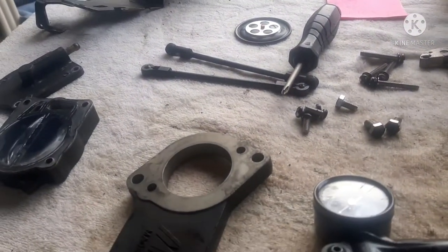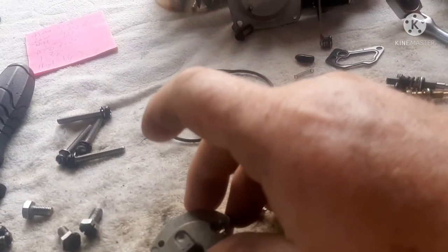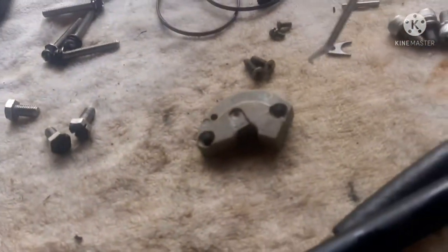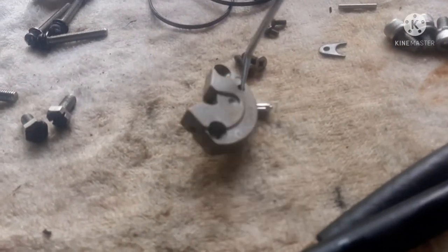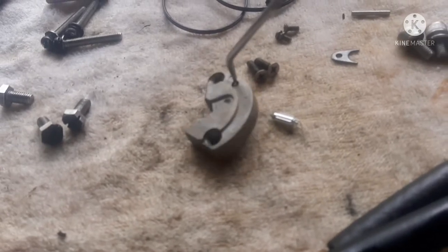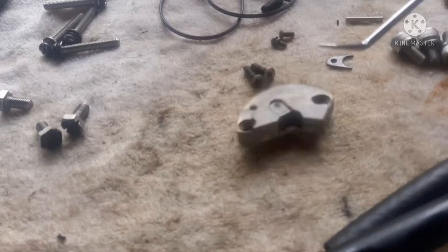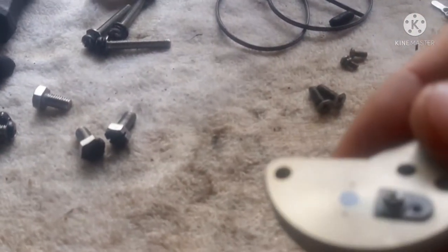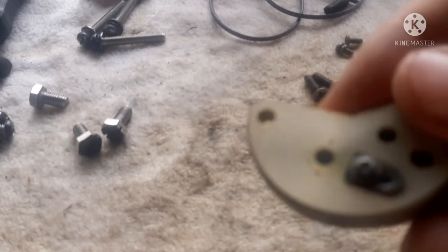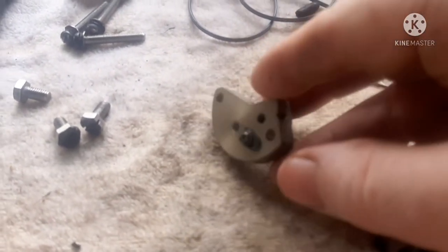Just some tips I've come across: this piece inside the carburetor can get clogged, and I've had to use a pick to clean it out — from old gas sitting in there, I suppose. This one was still wet when I pulled it apart. That port runs to the valve on the back — a little plastic piece you can see shining there. There are also some other tiny holes next to it that can get clogged.